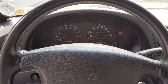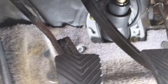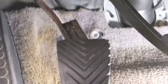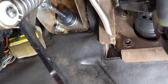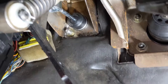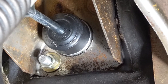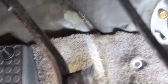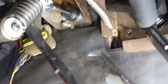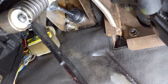First we're going to hop down underneath the dash. On the driver's side, if you look at the top of your clutch pedal, you'll notice a rod pushing through the firewall with a little black boot — that is your clutch master cylinder. If the bottom has fluid around it or liquid leaking down the inside of the firewall like mine did, you can probably see the carpet staining. It's a very slippery mess, which means your seal is blown out.